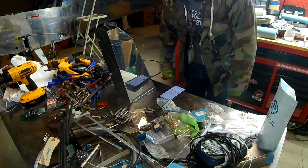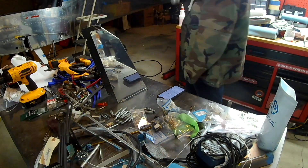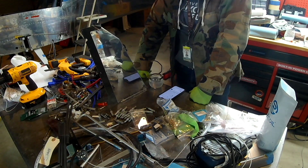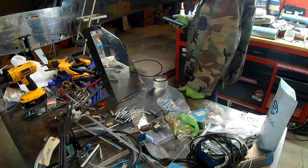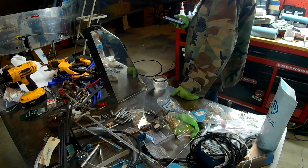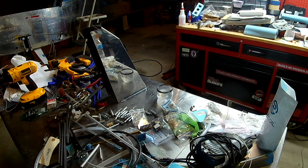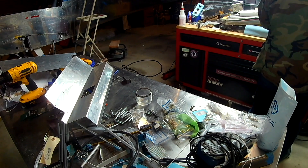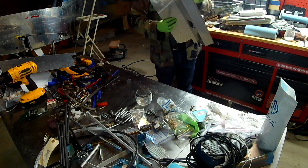In this plane we will have an O2 sensor — it's heated, it'll be behind the number four cylinder, and it'll be turned on about a minute before the engine fires up so that it's nice and hot. That way when the lead comes, it has a better chance of being boiled off or deflected rather than having a place to stick, cool, and ruin the sensor. The sensor allows you to have a closed-loop system to really tweak the injection, since it'll drift over time.